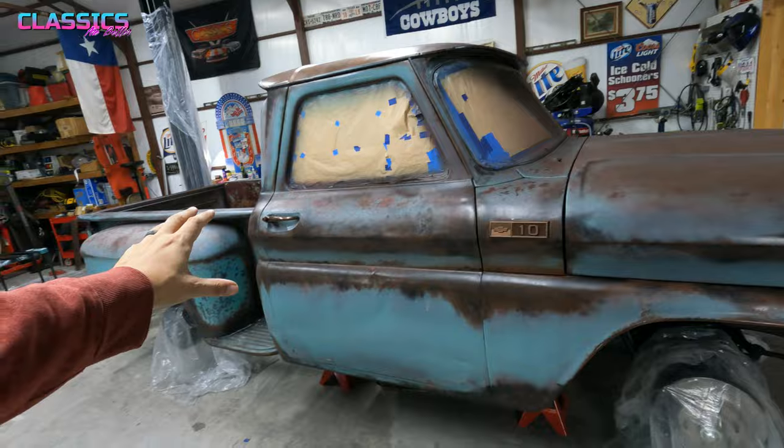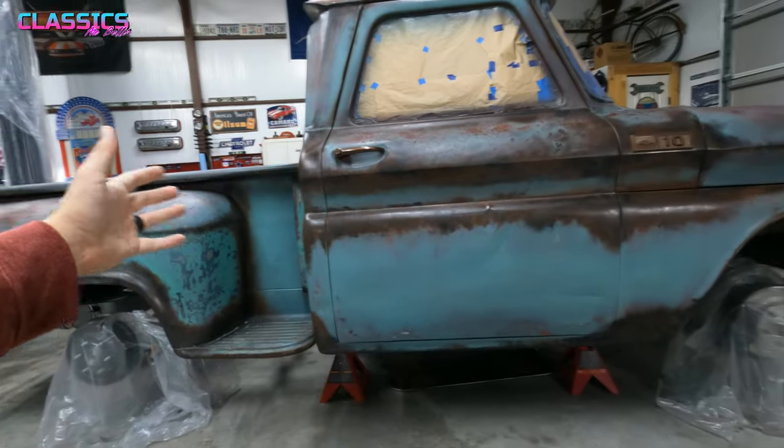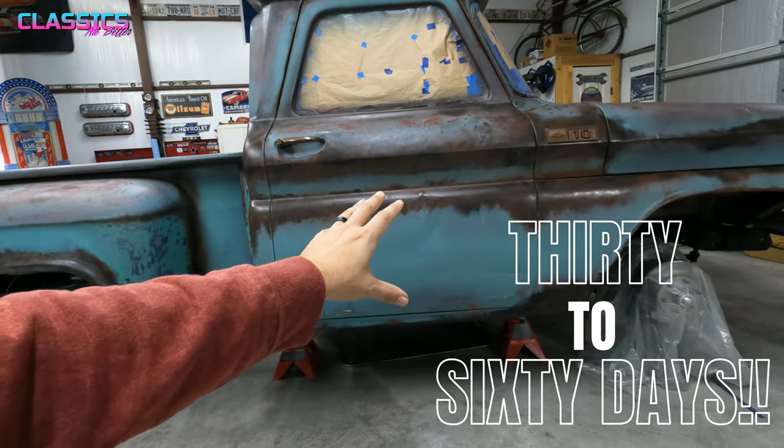Well, that's gonna be a bit of a problem for me. The route I decided to go was like, hey, let's just clear coat this with a semi-gloss or a matte — something like that. I just wanted the wet look but without it being really shiny. Turns out I know nothing about paint. The 503 light green I bought is a one-stage acrylic enamel, so I was asking my options — if I could still just spray clear over it. Turns out that's not a good idea. There's going to be spots that look really weird where it's just not going to want to stick. And it turns out this needs a good 30 to 60 days to chemically cure, so we're just on hold with that for now. I'll probably end up just getting some kind of really good wax.